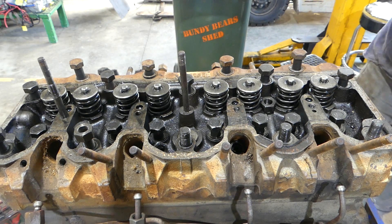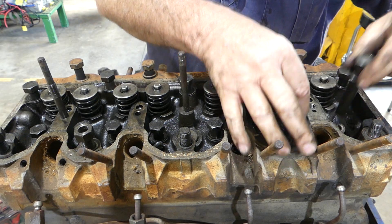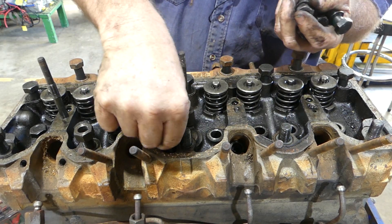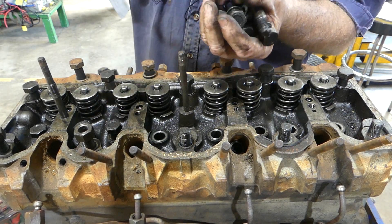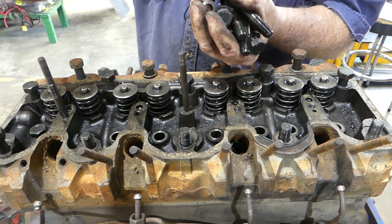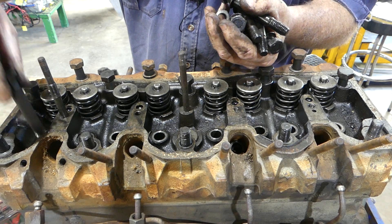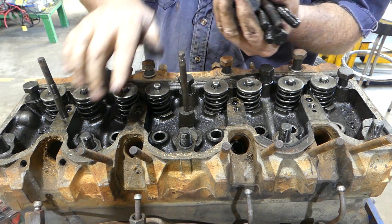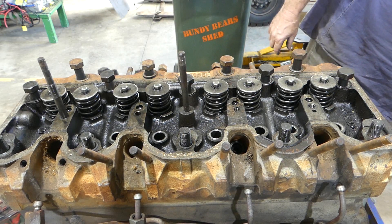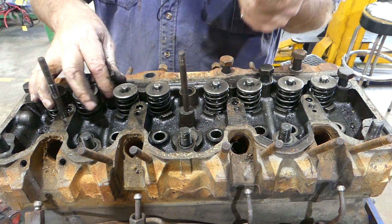After all that noise, that should be it. With all of these bolts I like to put them in the tappet cover — the rocker cover, whatever you'd like to call it — because they come out of that cavity under the rocker cover. You'll notice under the nuts there are no washers at all, but under the bolts there's a washer on every one. Just something to take note of.